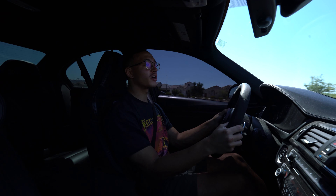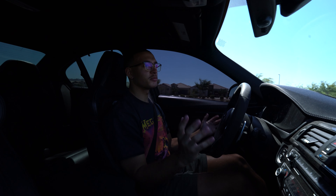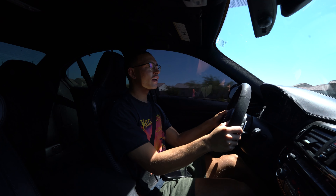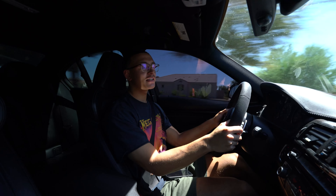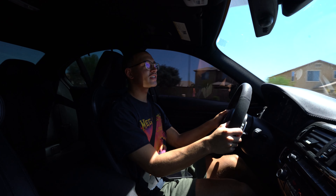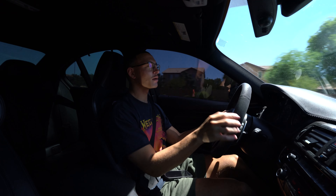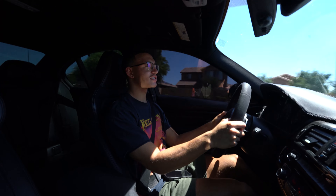Let's find some open road. We're going to be braking really hard, so you don't want to be near other cars. All we're going to do is get our car up to 60 and brake about as hard as we can without locking up the wheels — because we don't want to flat spot our tires — but as hard as you can down to 30 miles an hour.